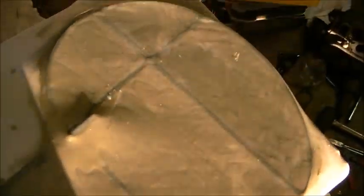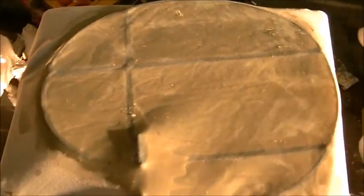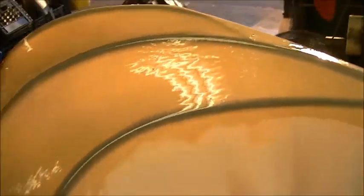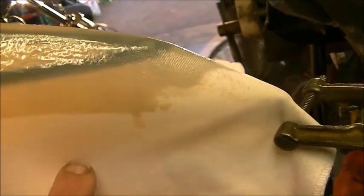It might be a little hard to see in the sunlight, but there you go — one layer of soaked-in resin. We're just going to flip it, do the other side, and that one's dry. The other side here is the end of the wing — that really hard curve to hit. Just had to do these two panels and it soaked through nice. I've got one little raised area right there but you're not going to see it. It's cut off the edge — I just resined it to the edge so I can grind it off, and then later come back and do a touch-up on the edge. That way when we paint it, it's painting fiberglass and not metal.